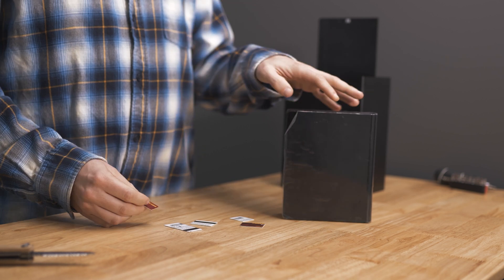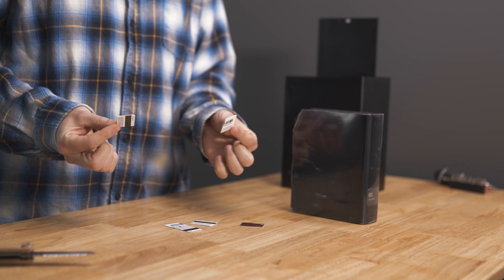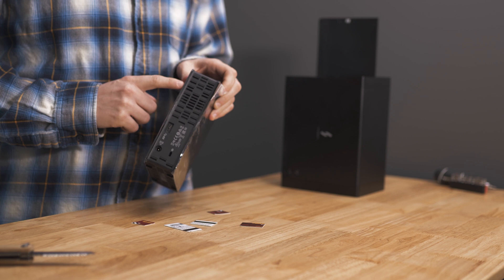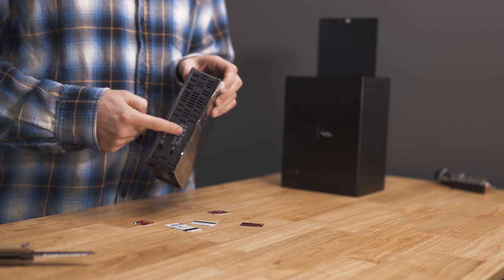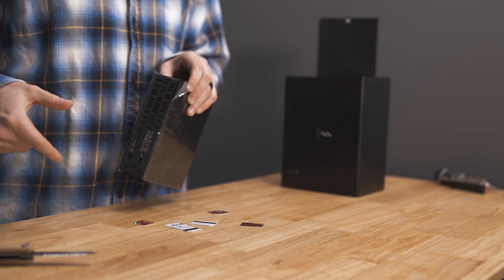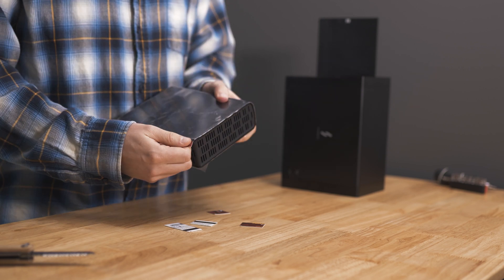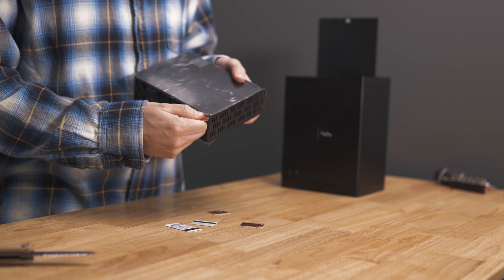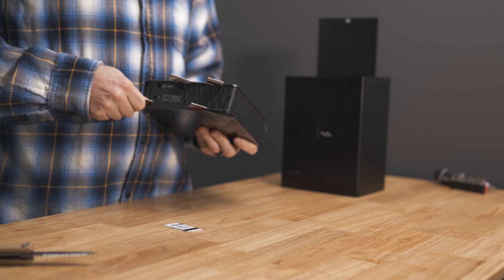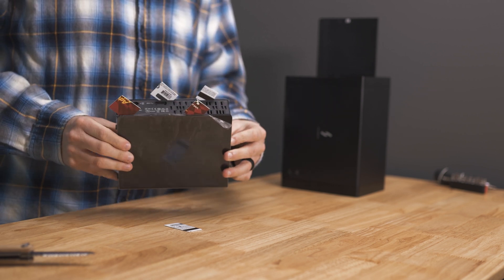Don't be afraid of the labor of taking these drives apart — it's very easy. If you just look up how to shuck Western Digital EasyStore, there are a couple of really good tutorials already on YouTube. The first thing you're going to want to do is cut up an old credit card or gift card into four or five pieces. The rounded edges on the card make this really easy. You're going to use the card pieces to separate the outer plastic shell from the inner piece that holds the hard drive. There are four tabs, and you're going to shove your credit card pieces in between to start to create a gap. Slide your card along that edge until you come to one of those tabs, and when you get all four pieces in, it's going to look something like this.